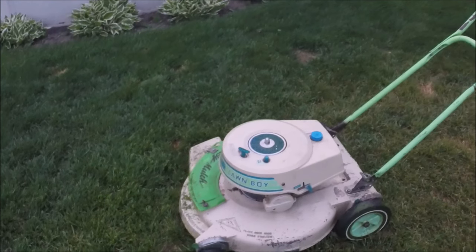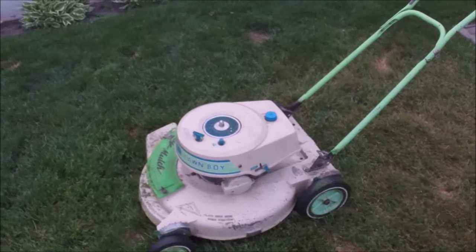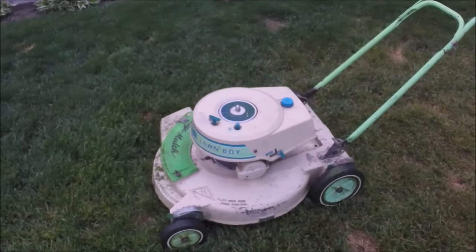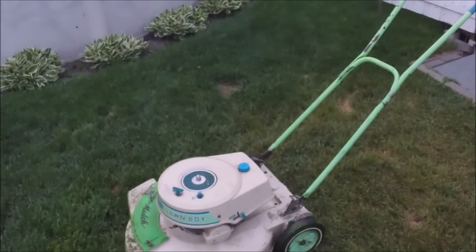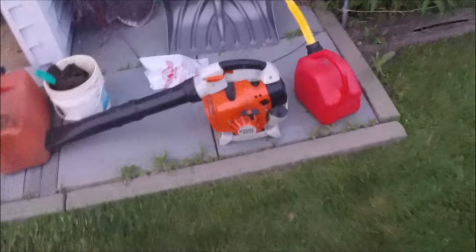Oh yeah, I do use a 16:1 gas oil mix for this Lawnboy because it has a two ring piston design and it has a bronze bushing on the crankcase, so it's important to keep that part lubricated or else you'll blow your motor. And for those of you who are wondering, I use Opti2 oil. Great oil. And now to finish off the blowing,